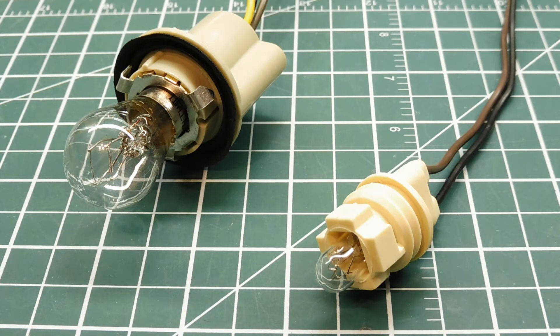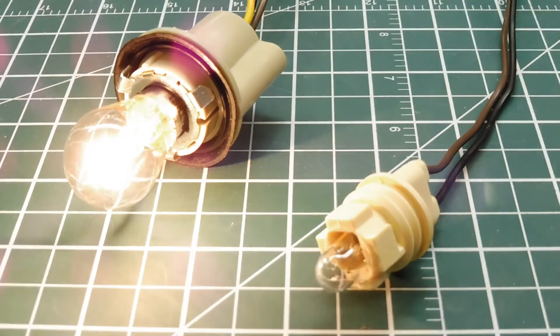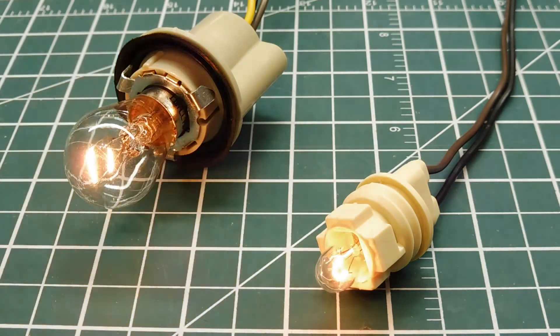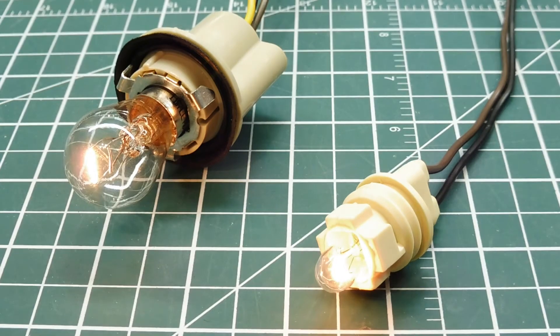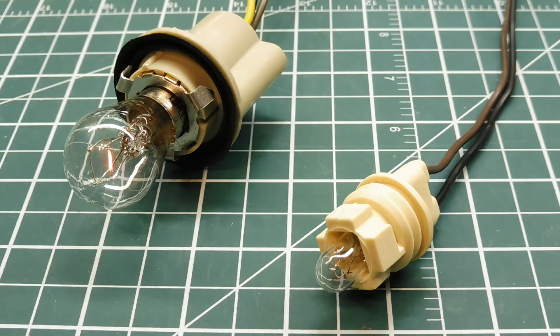During the night, I turn on my parking lights. You can see my parking light is on the 1157 bulb and my side marker is on. Now if I go to blink to make a turn, the blink alternates because the parking light is on — this gets more attention when you have an alternate flash. Now if I turn off the parking lights and blink, it goes back into unison. So that's the circuit.